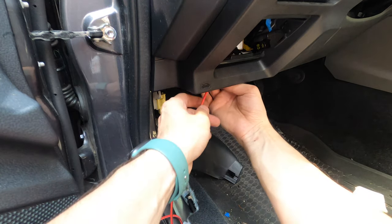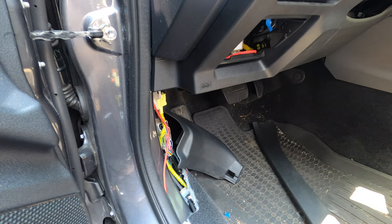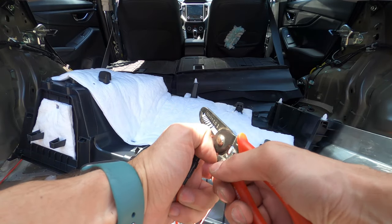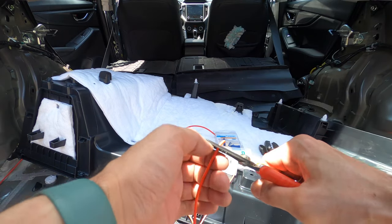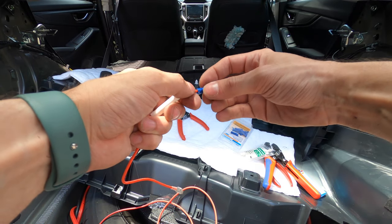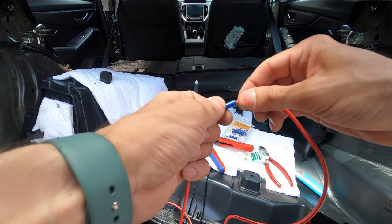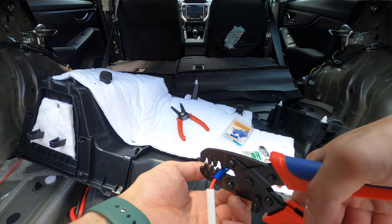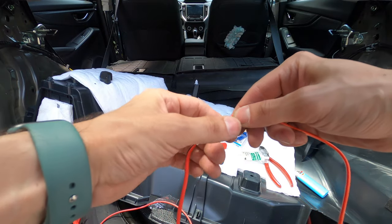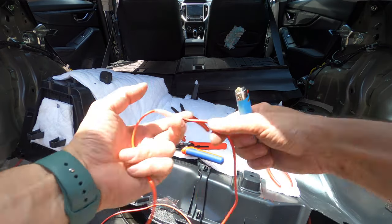Insert the fuse tap behind the lower dash. I'm going to connect the circuit I identified earlier, tuck the wire behind the lower side panel, and then head to the back of the car to wire in the socket. I took the wire connected to the socket and cut off the fuse that was attached because we already have a fuse at the fuse tap. Strip the end of the wire and twist the end to prevent any fraying. Slip on the heat shrink, grab a terminal connector, and crimp the terminal for a good solid connection. Slip in the wire leading to the fuse tap into the terminal and crimp away. Slide the heat shrink over the terminal and seal it up. Get a heat gun if you plan to do electrical work — a lighter is obviously not the best choice but it works.